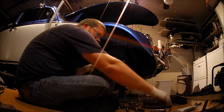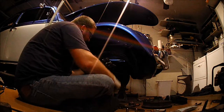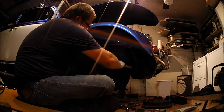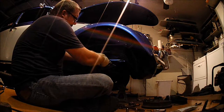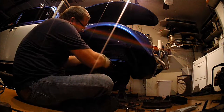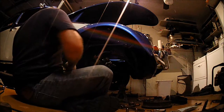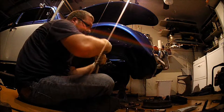Hopefully my socket is thin enough to fit in here — it's not the thickest area. Just deep enough to get into the bolts they got set up here. These bolts have lock washers on them. The instructions actually give you a torque spec for this: 25 foot-pounds. I'm going to snug them up and then put a little bit of torque wrench on it, set for 25 foot-pounds. That's locked.